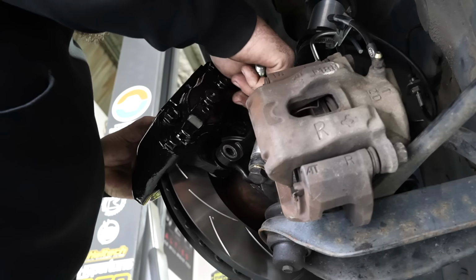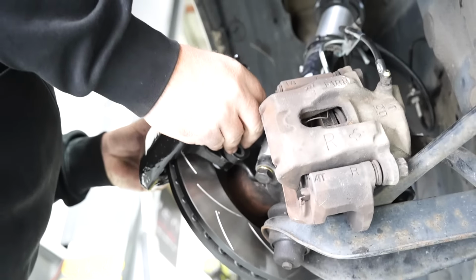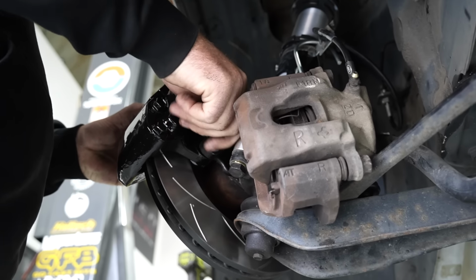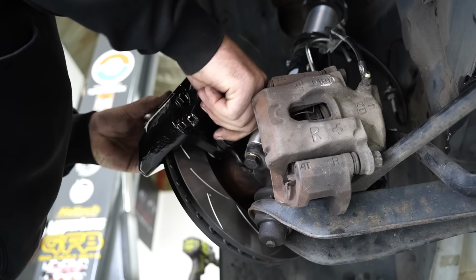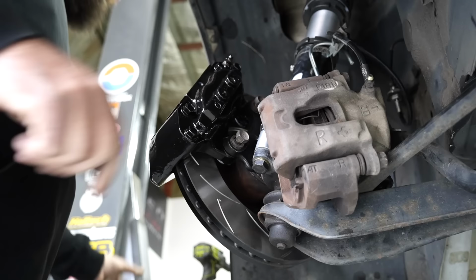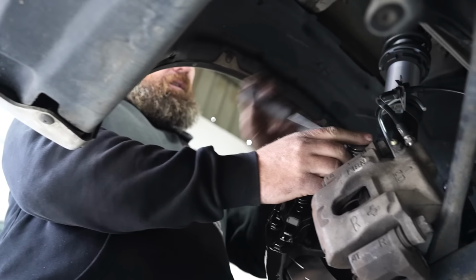So are Nissan brakes the best? The best? Probably not. Do they work? Yeah, definitely. So you basically use the Nissan brakes because of the compatibility across platforms? Yes. They're very common, good value for money, good bang for buck caliper. The pads are common as well, they're actually common to Subaru as well, so part shops are always going to have them. It's not weird consumables.